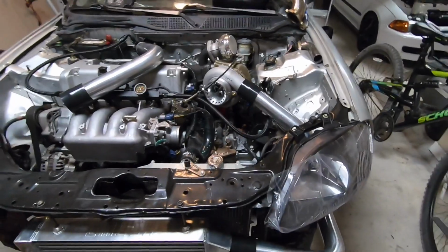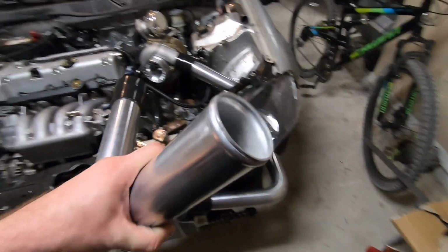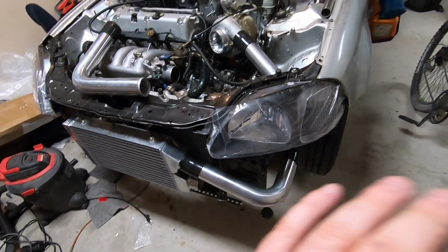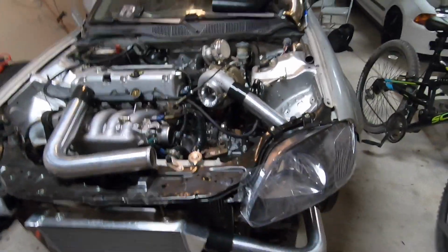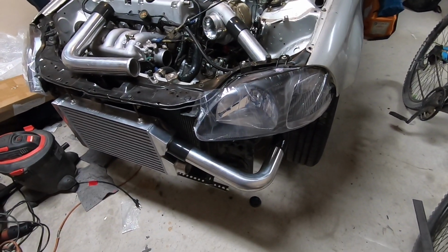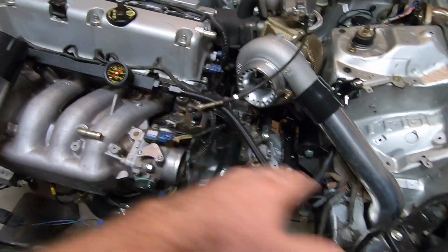I have to emphasize this because it's super important. All these pipes, let's see if this one had it. Yeah, it does. All these pipes have metal shavings in them. So whoever cut these, probably in China, did not clean it. So hose them down, make sure they're really clean, triple check, quadruple check, and every time I cut it, I went outside, I hosed it, made sure it was all out. I'm gonna deburr it, clean it, and probably leave this section where it is and start working on, I don't know what you call it, the throttle body part of the intercooler.